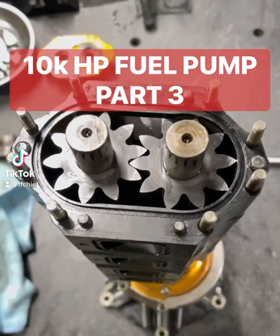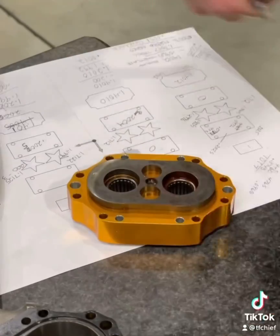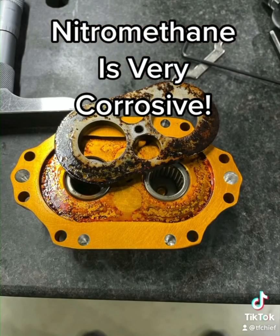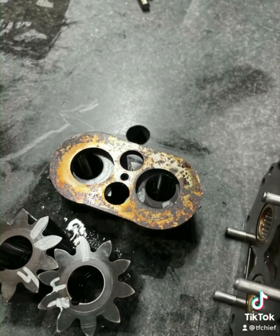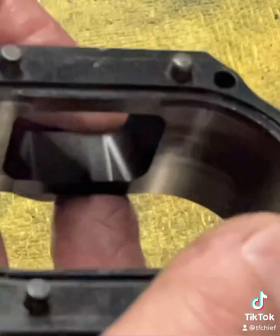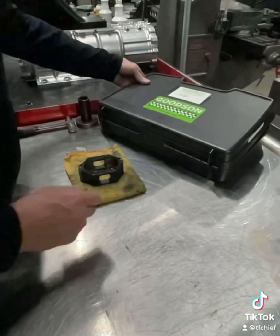Part three on our fuel pump rebuild. It's time to remove the wear plates off of the housings themselves. And at no surprise, we've got a lot of corrosion — not just on one, two, but four. This corrosion actually changes the tolerance between the gears and the wear plates. There are also some nicks and stuff like that along the way, so we're going to have to remove these small dowel pins off these housings so we can sand them.